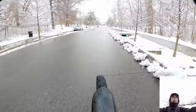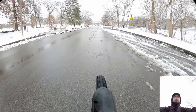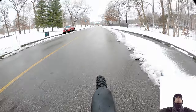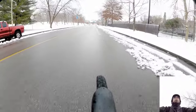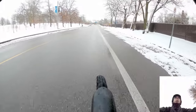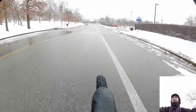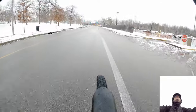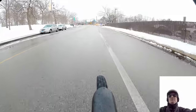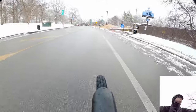Now keep in mind also, if you're riding a road bike, sometimes they may come with different wheel sizes. I've noticed that sometimes, on a really small frame, it might have 650, was it 650B, instead of 700C or something? So you just gotta pay attention to the specs a little, because 700C is essentially standard. It's been that way for decades now, really. It's not really a new thing anymore. So if you're not sure if you should get an extra small or a small, you may want to get a small if it has regular size wheels on it.